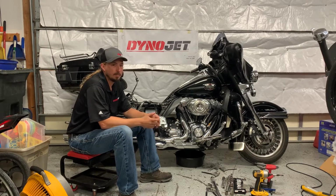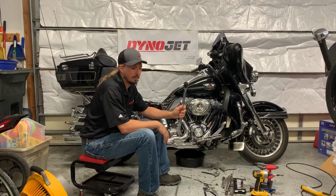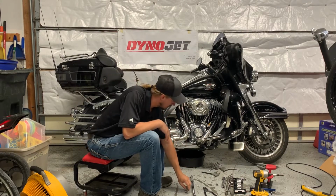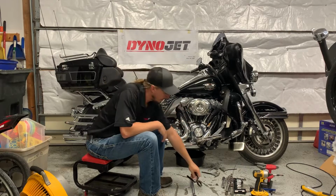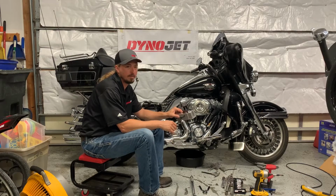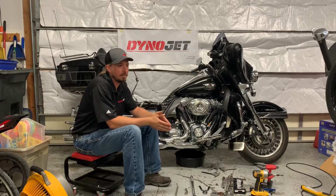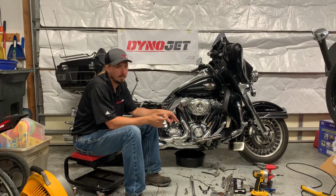A couple of more specialty tools that you might not have if you haven't done a project like this before are going to be a torque wrench, some feeler gauges, a piston ring expander, and a piston ring filing tool. Another thing that's recommended is to have a piston ring compressor, and I'm not going to be using that myself, and I'll also point out that having the piston ring expander is considered optional, but beneficial.